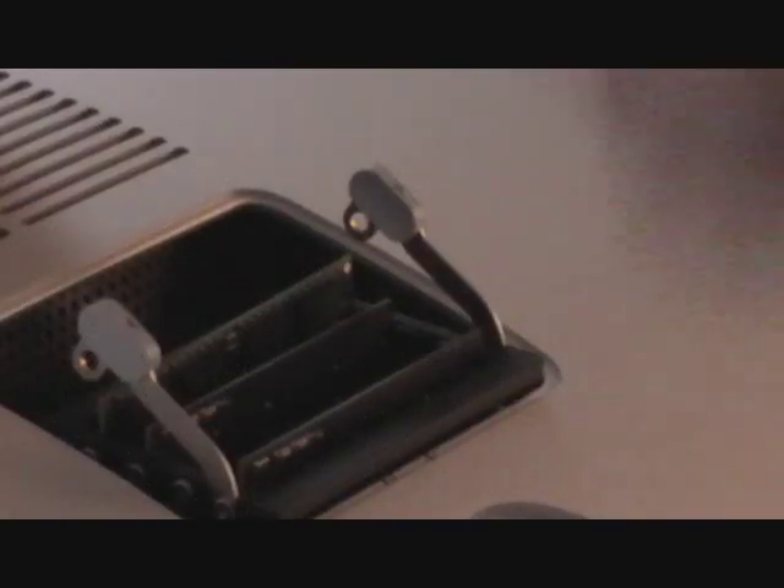So what I'm going to do is try to zoom in as best I can and install the RAM. Trying to seat this correctly. You want to stick it where the notch is on the right side if you're looking at it, and you want to stick it straight in. Then with both thumbs I give it a little push — not too crazy, just a little pressure — and you hear it kind of click. Then I reseat this, which should be good.